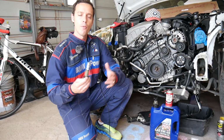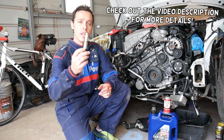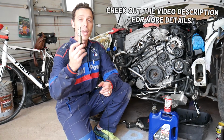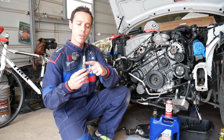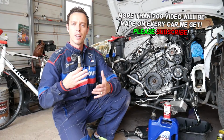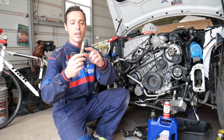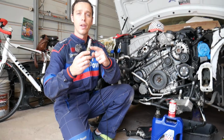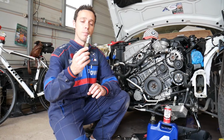Today will be a super helpful video to any of you that have a BMW X3 and need to clean your Vanos solenoid, intake or exhaust. Let's say you have the service engine light on, a code related to Vanos, or timing retarded or timing problems. We'll explain how to clean that, and that way you may even save it and not buy one. Seven out of ten times that we do that at the shop, it solves our problem and we don't need to buy a solenoid.